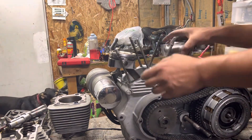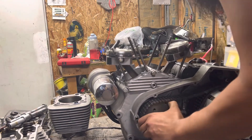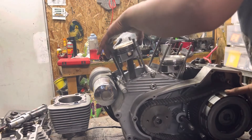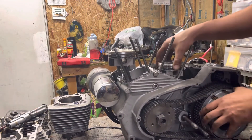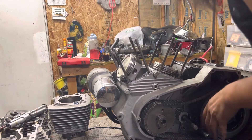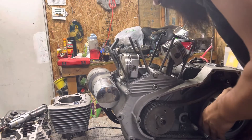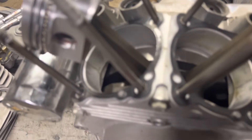Pistons are new. Now with everything off, there are actually some markings here on the crank: 3-3-1-8-2-6. I'm rolling the clutch basket around to feel what this bottom end feels like. I'll check the rods in a minute — just want to give everything a quick visual to make sure nothing red-flag stands out. Everything on this motor does look really clean on the inside, pretty clean down there.